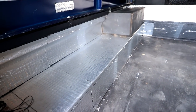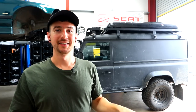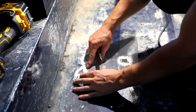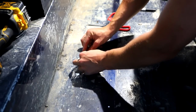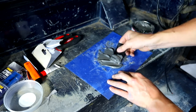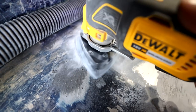Look at this — no more holes, and we have sound deadening, which is a game changer. I didn't film it properly, I just wanted to bash it out, but I did get a few clips. There were loads of holes everywhere — corrosion holes and drilled holes. For the bigger ones I had to make an aluminium mesh template to plug the holes, then use chemical metal filler — mix a hardener in and it becomes rock solid after 20 minutes. I filled all the holes, then sanded them all down smooth.